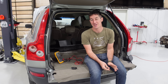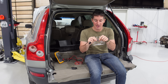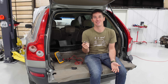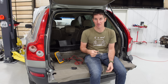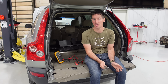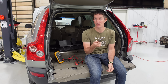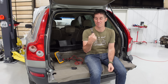The next generation put an RFID transceiver chip — a little pill — inside the plastic shroud of the key. These are actual chip keys, supposed to be state-of-the-art. Chrysler calls this SKIM — Sentry Key Immobilizer. While those older VATS keys were simple to copy, this is incredibly hard for a normal locksmith. As a home user you can't fix your own car anymore, and people charge up to $150 or more for a key that's worth a dollar.